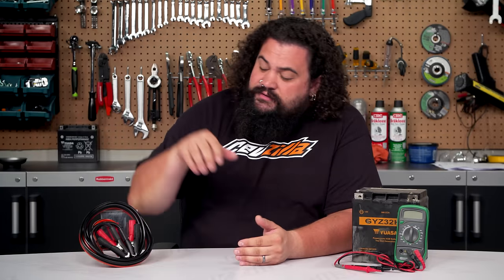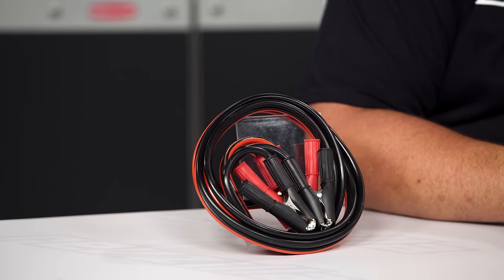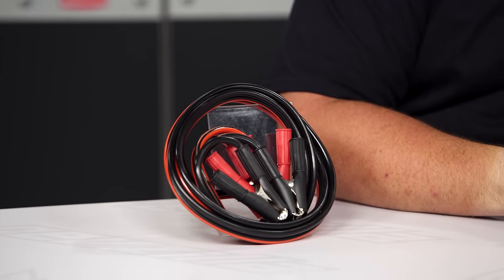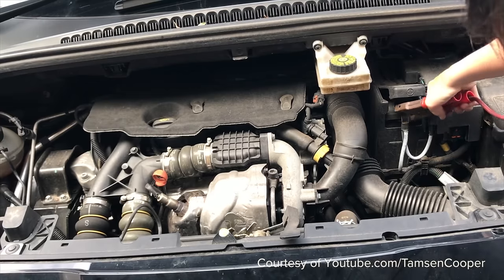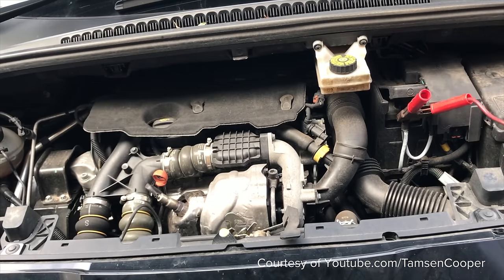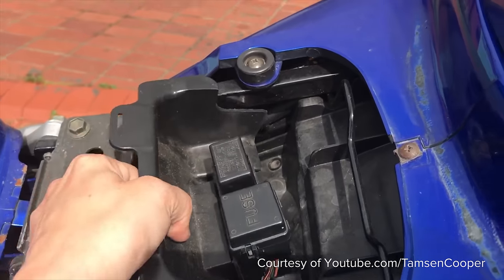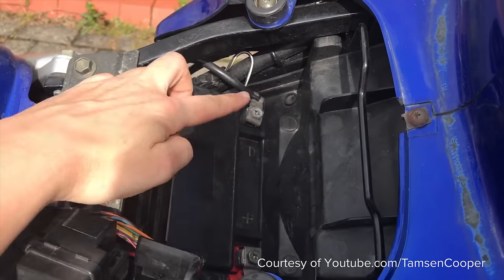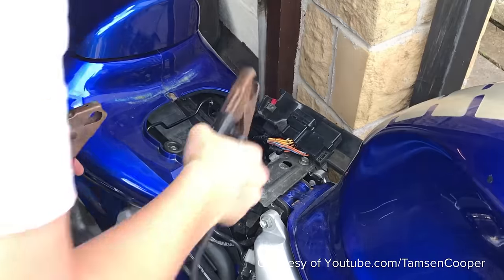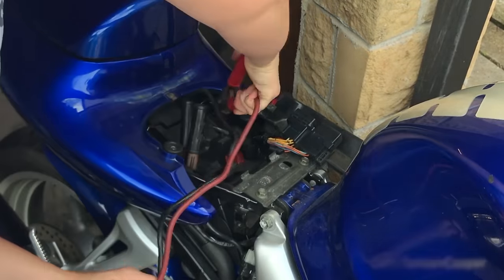The first is this. If you're using a set of automotive jumper cables — not these little motorcycle ones — be really careful when you go to jump on the motorcycle side of things. A set of automotive clamps are much bigger; they're usually four or six inches long, and you can open them up with your entire hand. They work fine on a car simply because you have all that room in the engine bay. However, the clamps for a motorcycle can be really unwieldy, simply because your battery terminals are often very close to the frame, which is usually used as a ground. It can be very easy to introduce a dead short if you're using automotive-style jumper cables on a motorcycle. Just be really careful that you don't have that problem.